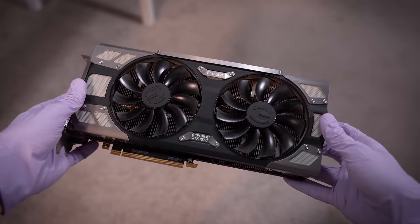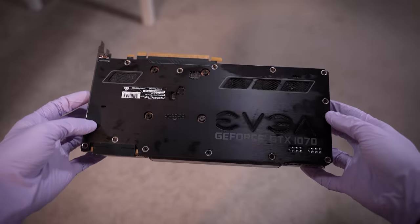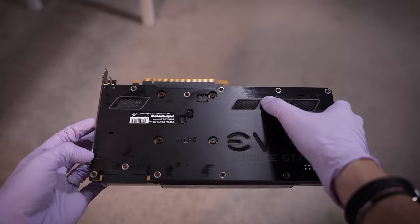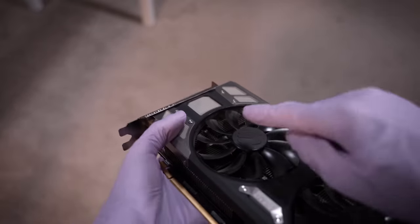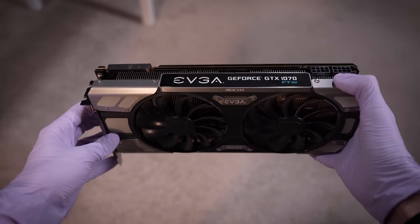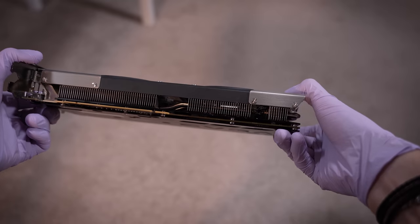This here is our For The Win GTX 1070 from EVGA. Several years old, though I think the design is fairly timeless — you couldn't tell just by looking at it. You can see the oil stains and residue here, usually from thermal pads that get heated up and cooled over time. The oil in them tends to seep out and stain back plates and the PCBs underneath. There's also a lot of dust in and around the fan blades. When you deep clean a graphics card, I recommend you fully disassemble it. There are a lot of small crevices you'll miss if you just take a can of air and blast the fans and heat sink.